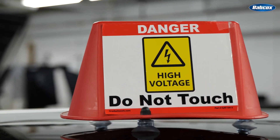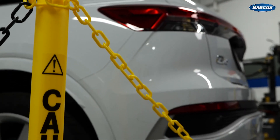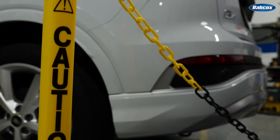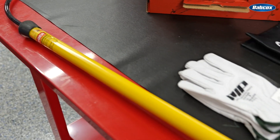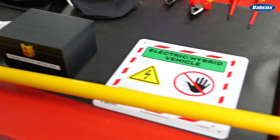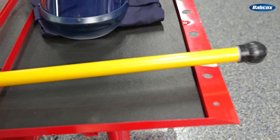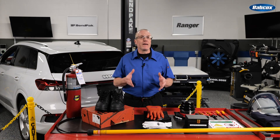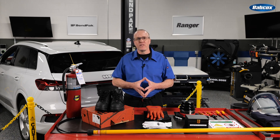The work area where the vehicle is located must also be properly prepared. It must be clearly marked and cordoned off with bright safety cones or stands and tape to warn everyone that work is taking place on the high voltage system. It's also required to have a safety hook, also called a rescue hook, so in the event a technician comes into contact with high voltage, another technician is able to use the hook to physically pull them away from the vehicle. For this reason, it's recommended that two people are present anytime work is being performed on the high voltage system of an EV.